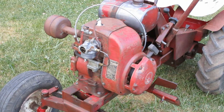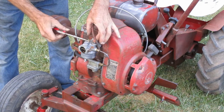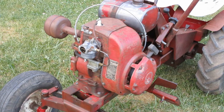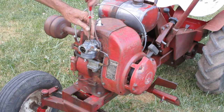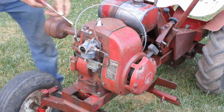There's a little more tapping noise than I like to hear, so I shut it down to regroup. I checked the oil off camera and that looks good. I'm going to turn the idle speed screw in a little bit — it just helps keep it running while I'm messing with it. I want to know how far these screws are out, so I'm going to count the turns as I turn them in and then bring them back out to the same place.